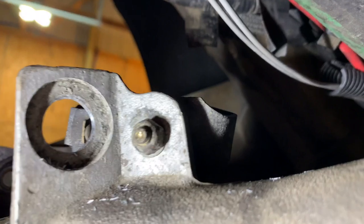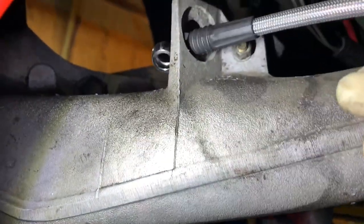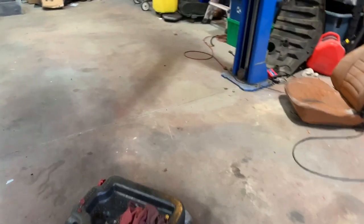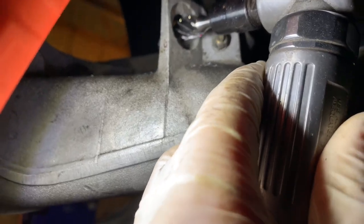So I did it off the video. So you can see the shavings there. Now this actually fits through. So you will need to get your little die grinder or air grinder, like I have here. And I only did it for probably about 3 seconds. Put it in there, just very lightly hit the edges, and then it'll slide through.